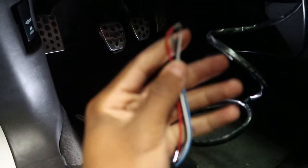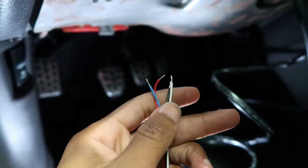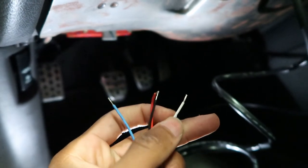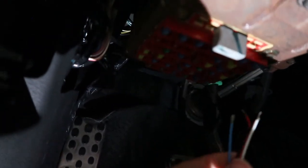The next thing is to take these wires — I'm only going to use the red and the black one today, since those are the power and ground. The blue one is for whenever I'm ready to data log, but I'll need an adapter for the end to connect to my handheld tuner. The white one I'm not sure about, so I'll leave it unless I need it for data logging. Let me go ahead and pull out fuse number five, which is for my instrument cluster — I'll attach the power to that and the ground to one of the bolts around here.